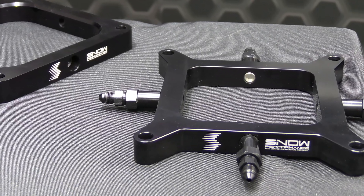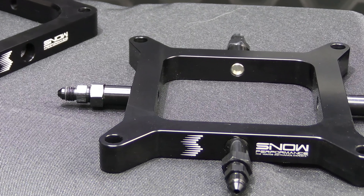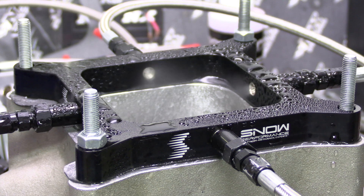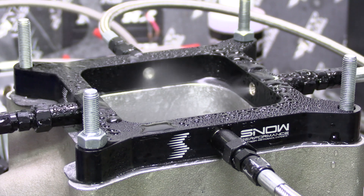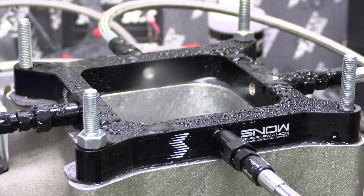The second way is better cooling of the intake air charge — we often cool intake air temperatures 50 to 150 degrees, meaning a denser air charge for more efficient power. If these methods are used, it's not uncommon to see a 20% increase in horsepower in forced induction applications and a 5–10% increase in naturally aspirated applications.